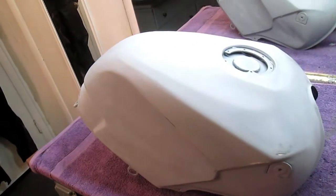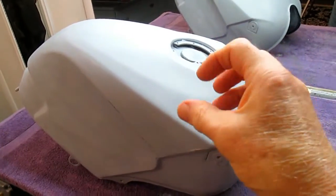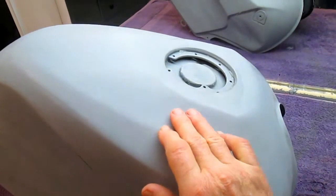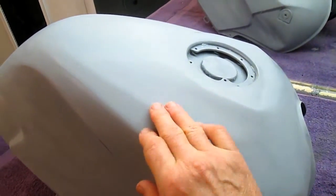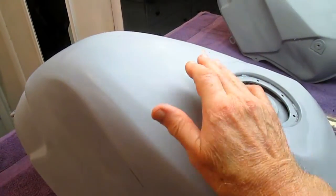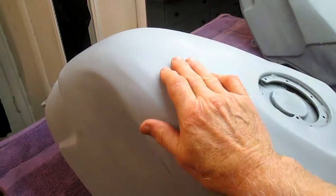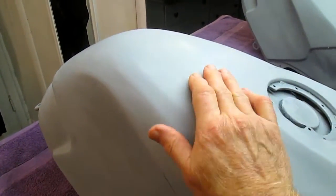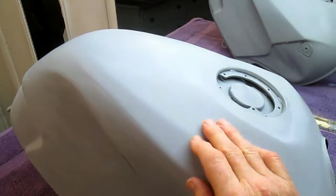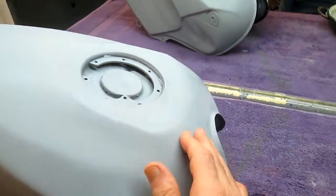One of the reasons for doing this with 600 grit instead of 1000 or finer grit is I want to leave a little extra tooth on there. Now, in the spots I still have to do by hand, I'm done with the block. The sequence is always, if there's any real change in shape, I'll do a hard block. Once I have the shape I want, I'll do a soft block, but I'll always finish it up by just doing it by hand, because your hand gets in all these little corners and edges. And I can do all of this by feel, either with a glove, without a glove.